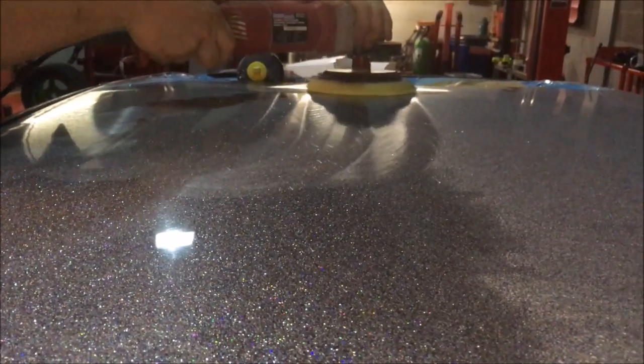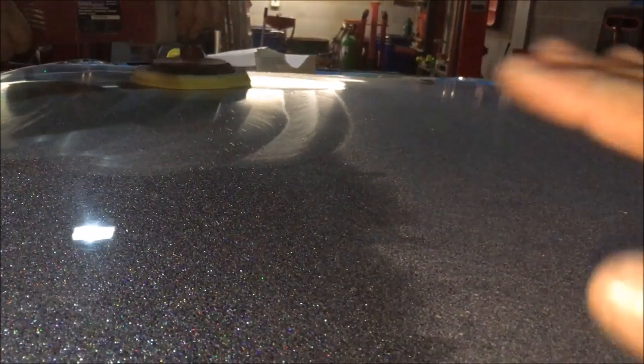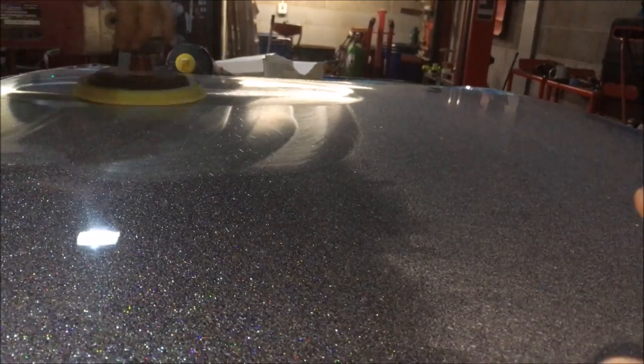So I came in with the 1200, the whole thing nice and flat, then the 1500 to get it smooth. I put three 1200 pads and then three 1500 pads on the long block, the purple one there. Long cross-hatching motions to get the best finish, and it came out really nice. I went up to 2000 and 3000 on the DA, and that was fine as anything.